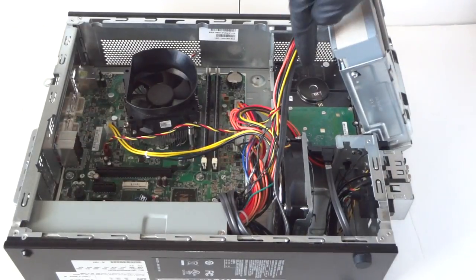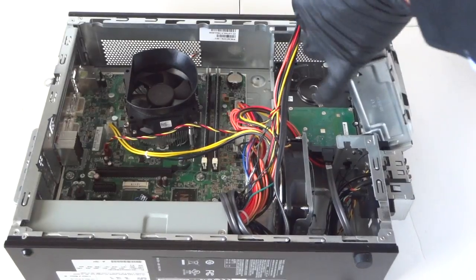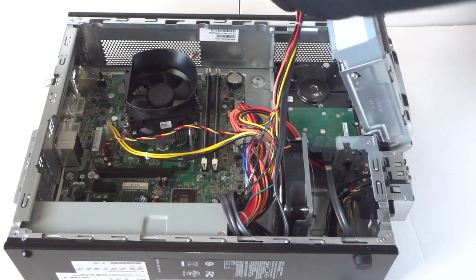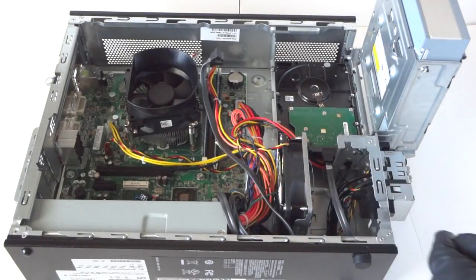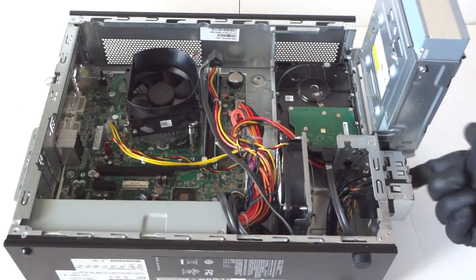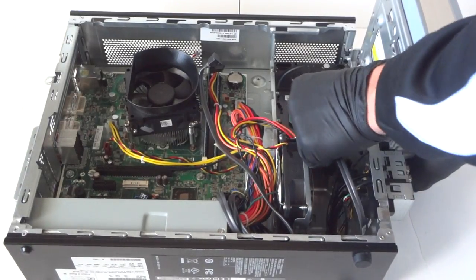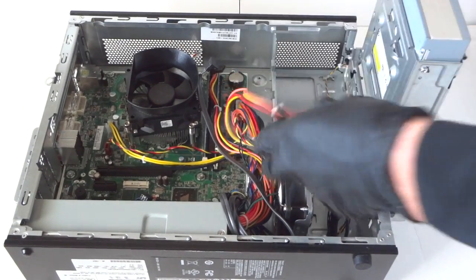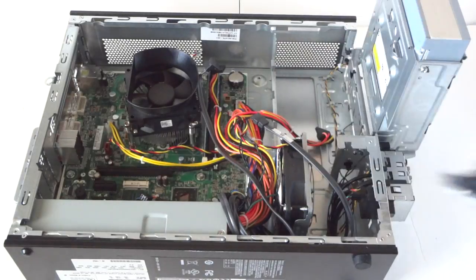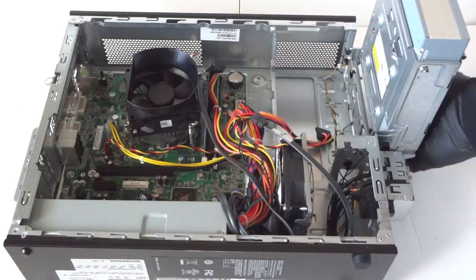The hard drive is going to be in the bottom, so you're going to disconnect the optical drive's power and SATA cable. There's a clip right here in the front — a secure lock that holds a screw. You press it to the right to remove the hard drive, otherwise the hard drive wouldn't be able to come out. Disconnect the SATA power — see right here, it holds it there, and it's a clip. You press it to the right, just like that.